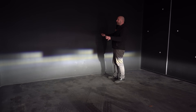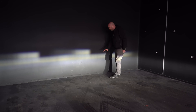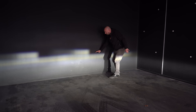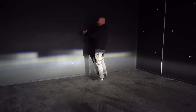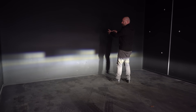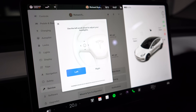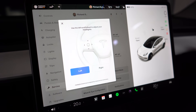For the adjustment for now, I'm going to do much the same thing — drive backwards and forwards, check this main level goes down as I get further away and comes back up as I get closer — and I want to make sure these are at least pointing off to the left-hand side of the car. I've gone to the service menu, adjust headlights, it's done a static calibration. Now some cars may require you to do a short drive first.